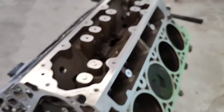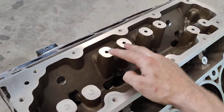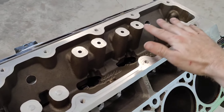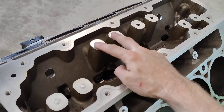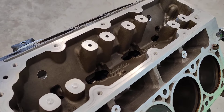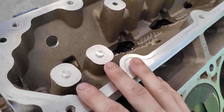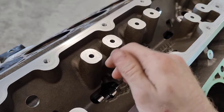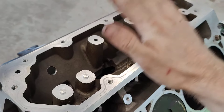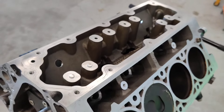What these plugs do is plug off your AFM towers. These towers are where oil is fed into the lifter via what's known as the valve lifter oil manifold — basically the whole plate that sits on top of the engine. It feeds oil into these passages, and that's how it locks and unlocks your AFM lifters. Since we're deleting all of that system, we just plug those up with the included plugs — you literally tap them into place, then put your VLOM or valley plate right back over the top. They slip right into the gasket so it doesn't interfere at all.